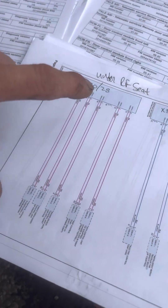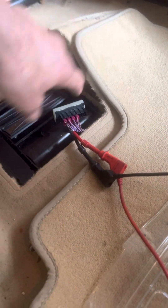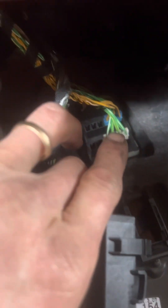This was the issue, and I literally tore this car apart. You've got a bus strip under the seat, another bus, two buses up under this seat as you can see. I'm into that vehicle dynamics bus — I've got a scope pattern for you. Your central gateway is at the kick panel, and there are a couple more bus strips there, plus some modules and more bus strips. Again, you see this thing lit up like a Christmas tree.